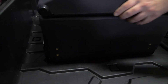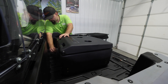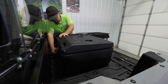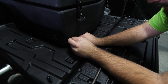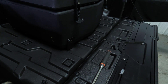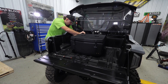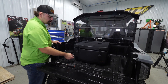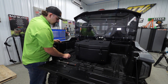With movement still available, take the cargo box again, lay it into place, and put your thumb screws in at the rear again. Put one in up front and one in the back on this side. Once all of them are started and everything is snugged up and you know all the brackets line up, remove all three thumb screws again.